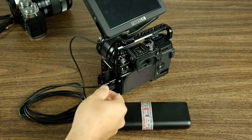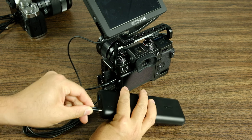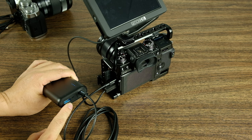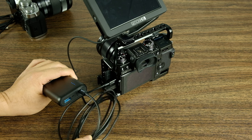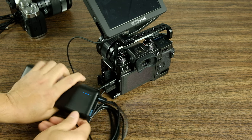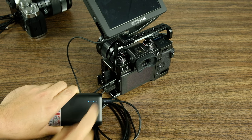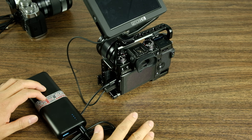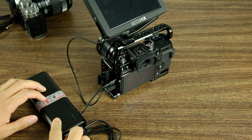It works very similarly to the X-T3. The micro side goes into the camera and then the USB-C side goes into your power bank. One important thing to note — even though there is a standard USB cable size over here, it does not provide the power delivery system. That's only provided on the USB-C side, which is the reason why we need the specialized cable. But once you have it plugged in, it'll go ahead and light right back up, and just like the X-T3, it'll actually start charging the battery if you have it plugged in, but you can also use it to power the camera.